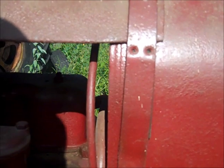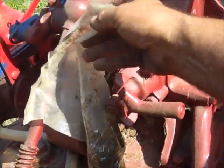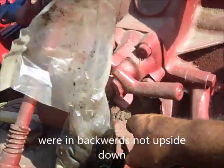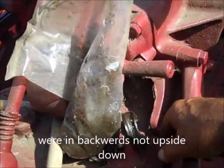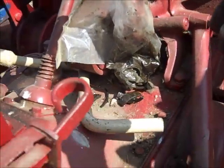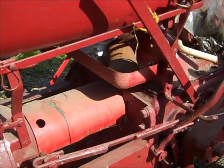Well, kind of smokes a little. Those two pistons in the middle are half gone. Right here they are in this bag. Somebody put the pistons in upside down and they just got all beat to pieces. And there's part of the pistons come out of the oil pan. But I don't know, we can fix it someday, I guess. Alright, that's enough for now.